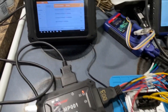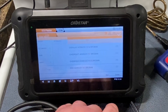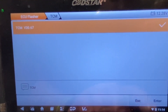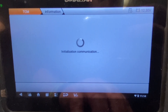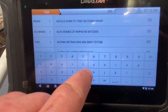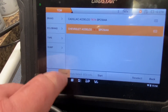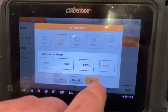The first thing we're going to do is back out of this, go into TCM, hit Enter, and click up here on T87A — when you click either one it doesn't really matter. We'll go to the pinout; we're going to be using the MP001 adapter today.